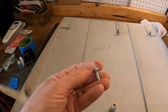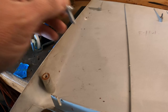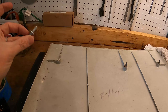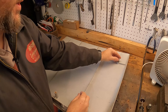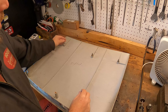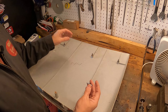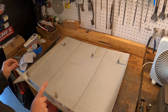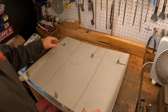We're not done with the epoxy because I have some missing studs. I got replacement studs from MPD but they don't fit exactly — they're a little loose, not screwing in well. No big deal, we're going to epoxy these into the holes. The replacement ones from MPD are also a bit longer — the back ones have a shorter stud because the boss is only so long within the scoop. One factory stud is stripped so we'll epoxy that one anyway. Since the aftermarket ones are also loose, we need to epoxy the outer ones. The center one I may skip since I might cut it out.